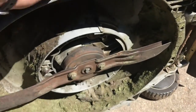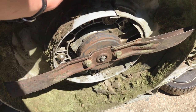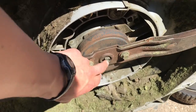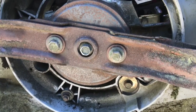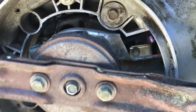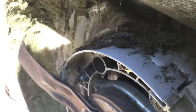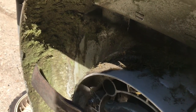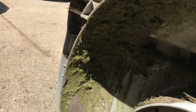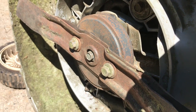After taking everything off I couldn't find anything visible, and after some research it could possibly be the crankshaft. I couldn't see it until I put everything back together and got the bolt on here. Now if I pull it over you can see it — you can see the blade wobble. So we've got ourselves a bent crankshaft. I've seen ways to fix it, but it's likely either junk it or leave it.